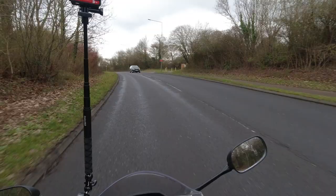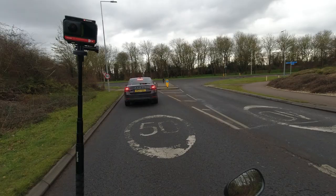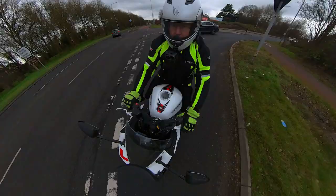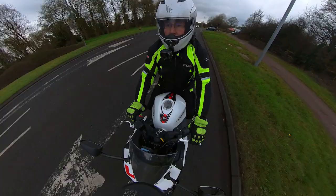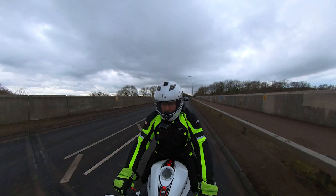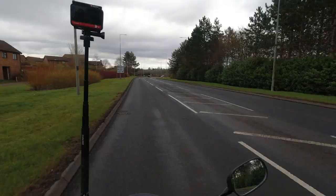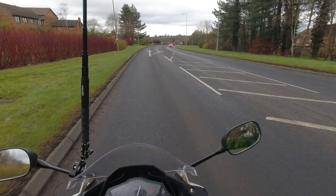What I did do on this one after this video was recorded is change the front sprocket from a 12 tooth to a 13 tooth. Now I know that everybody with the F series wants to go from a 13 tooth to a 12 tooth, but the Yamazaki YM50 comes with a 12 tooth as standard with a 55 tooth rear sprocket. When this gets up to the full rev range you're only looking at 45 miles an hour, and I believe this bike will go a little bit faster. So I decided to change that front sprocket to a 13 to give it a little bit less torque and a little bit more top end speed.